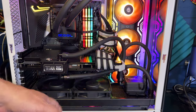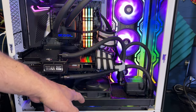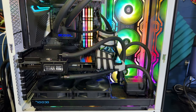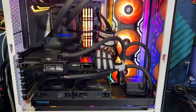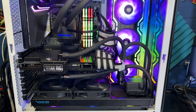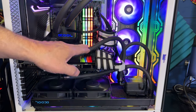I'm going to unplug that because there's really no need for it there. I put two non-ARGB fans on top of the radiator, so basically what I'm getting is a push-pull setup. The hot air in there is being pulled out through the radiator. The tubing went well.